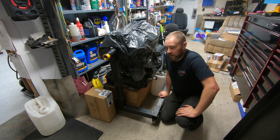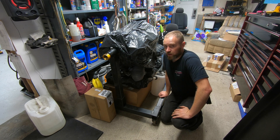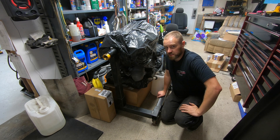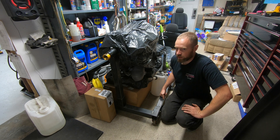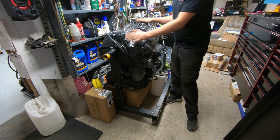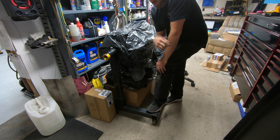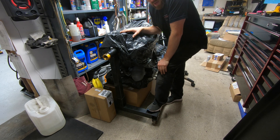I had to work with that motor quite a while just to patch up the little damage it did cause, because that thing hit really hard. I wanted to make sure I brought this mistake to your attention so you don't make the same one in your shop. Get one of these quality stands — well worth the extra money. And if you can afford it, those stands with a crank that turns the motor are really nice because they have a worm gear so the motor won't automatically flip over on you. Someday I'll get one of those, but I need a bigger shop first.